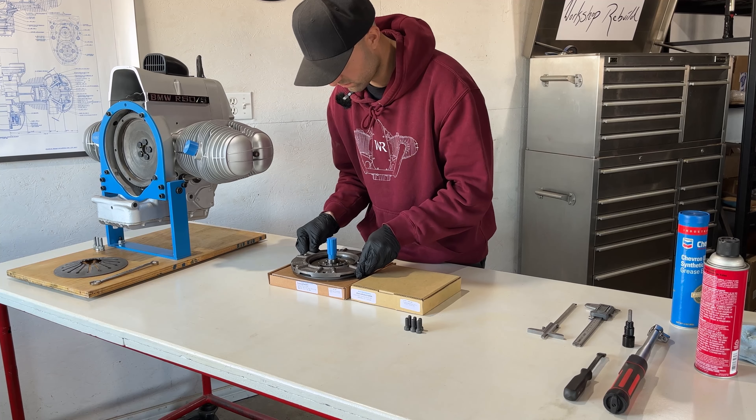For assembly assistance, three M8 by 1 by 30 millimeter long bolts will compress the assembly towards the flywheel before installing the Allen head bolts. Holding the diaphragm against the flywheel, push the assembly against it aligning the bolts with the flywheel bores. Thread in the M8 bolts halfway, then add three Allen head bolts into the flywheel for extra security. Once the M8 bolts are bottomed out, hand tighten the Allen head bolts.